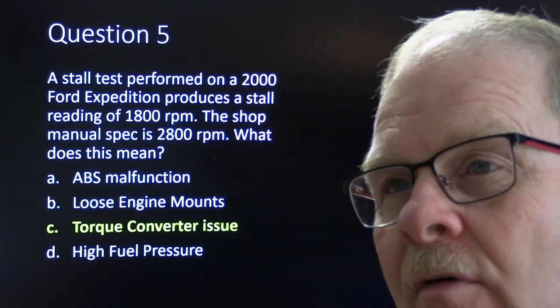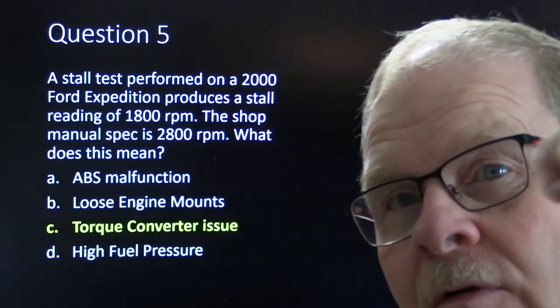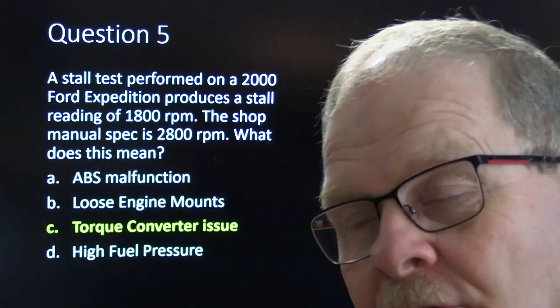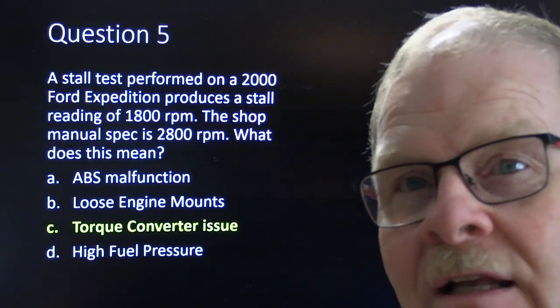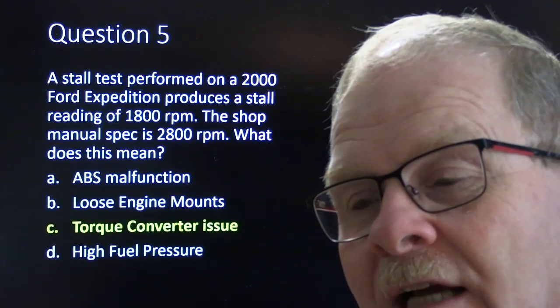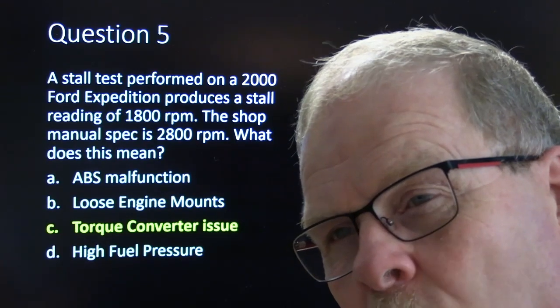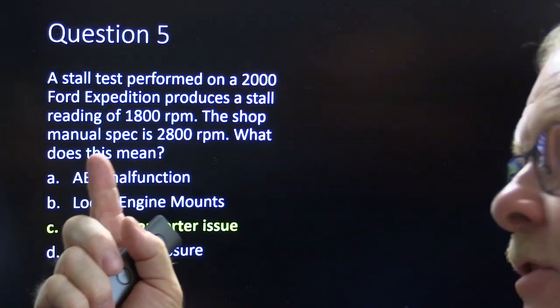Make sure there's nothing in the way. Like if you've got wide open spaces behind you and there's a building in front of you, I like to do this in reverse, so if it does try to get away, I can stop it before it causes damage. Anyway, hold your gas pedal all the way to the floor and see when the tach stops gaining RPM. That's your stall speed. And that's how you check the torque converter.